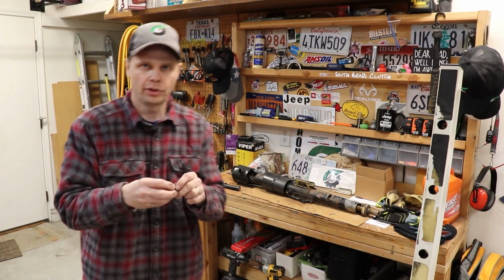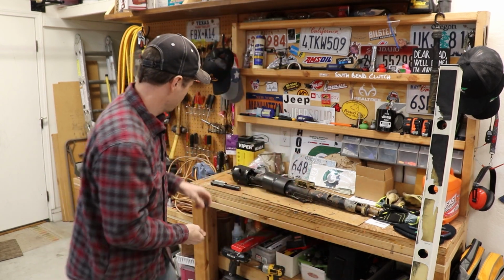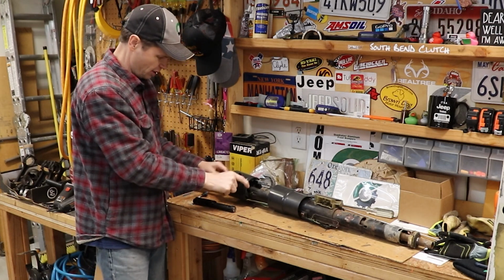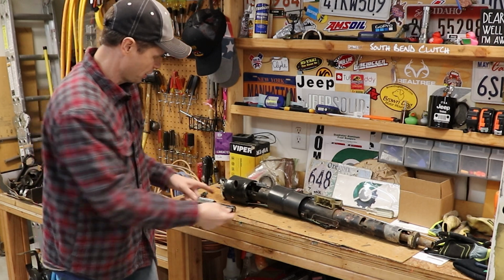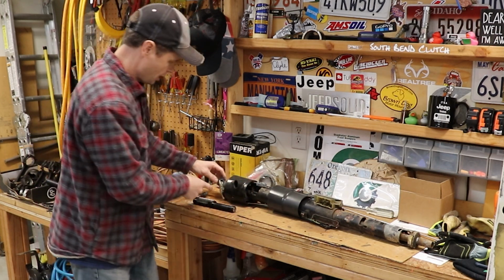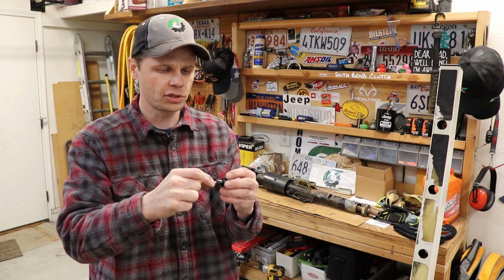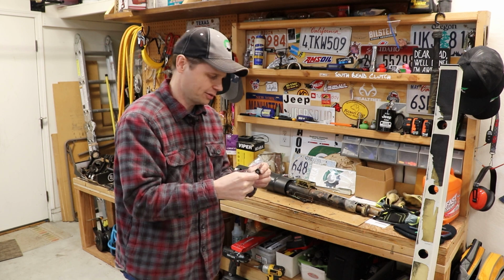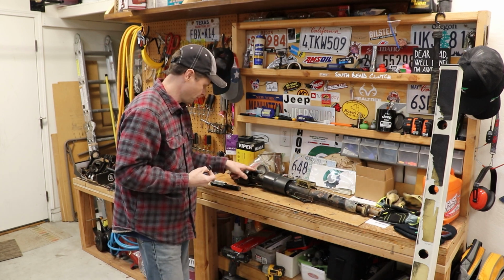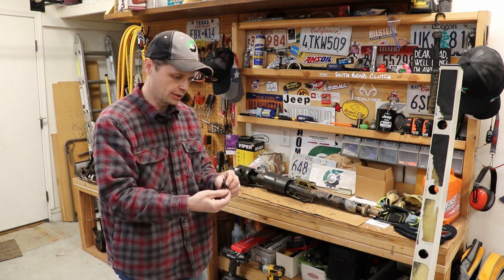So earlier in the video when I mentioned taking these four little bolts out to take out the turn signal switch here, this little mechanism, that was incorrect. These were part of separating these two shrouds here after this was off, but that's in my previous video. We're gonna order ourselves a new mechanism for the ignition here. This is just a cheap little plastic gear. That's great, thanks Chrysler. And then this little metal piece here, which is actually kind of worn down too, which is a little surprising being that this is plastic.